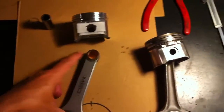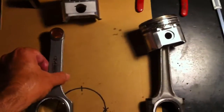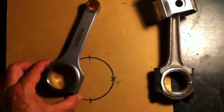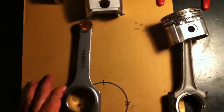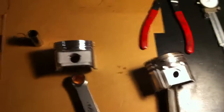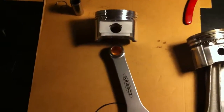What happens when you lengthen the rod — the distance from the crankshaft journal to the wrist pin — is you're able to reduce the angle of deflection the rod has to operate in. Every rotation, this rod goes through a full motion around this circle; it's a 3.2-inch circle that the stroke on these engines has. With a longer connecting rod, your rod angle is reduced. As the engine operates, the tendency of the rod to move side to side is lessened, and the load on the piston, the skirt, and the bore is lessened. This makes the engine feel like it has a shorter stroke in some ways, which is advantageous for performance if you're going to spin them up.